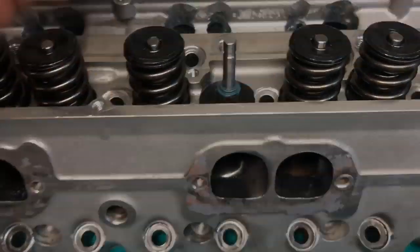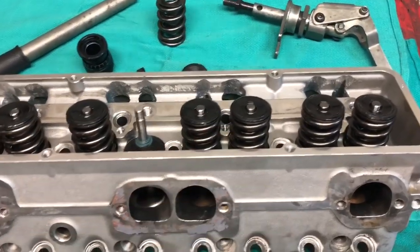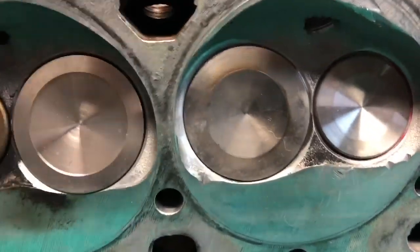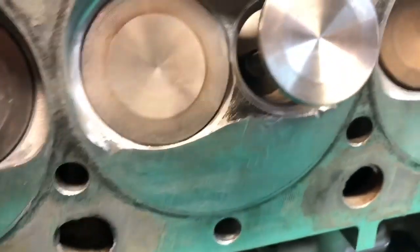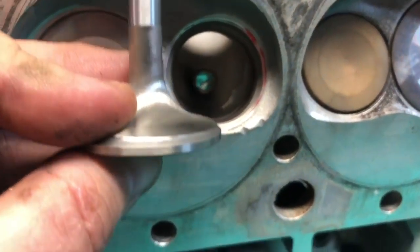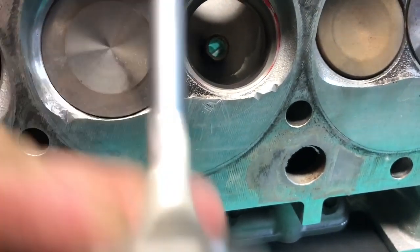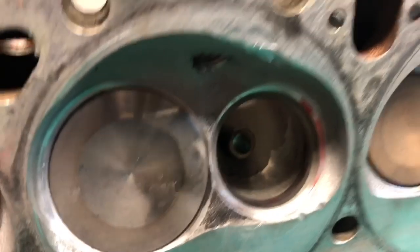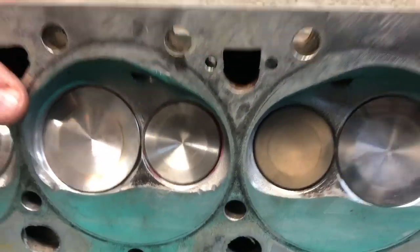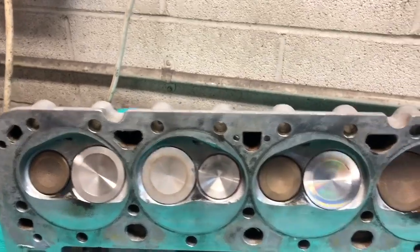Anybody that sets up heads should have this. I don't remember the installed height I need, so I'm going to pull off this neighbor here. The valve job guy just took it off so he could do the valve job and put it back together, but I want to make sure. You can see he done the valve job on these, and that's my new valve popped in there. He did have to cut it down a little deeper because of some issues, so you can see on the valve it's got a nice mark where it's touching — all sealed up nice and tight. He had to go in and port it out a little bit since the cutter had to go deeper. You can feel it — it is inset versus this one, probably 25 to 30 thousandths. So I am going to have to change the spring shims under that retainer to get it where it needs to be.